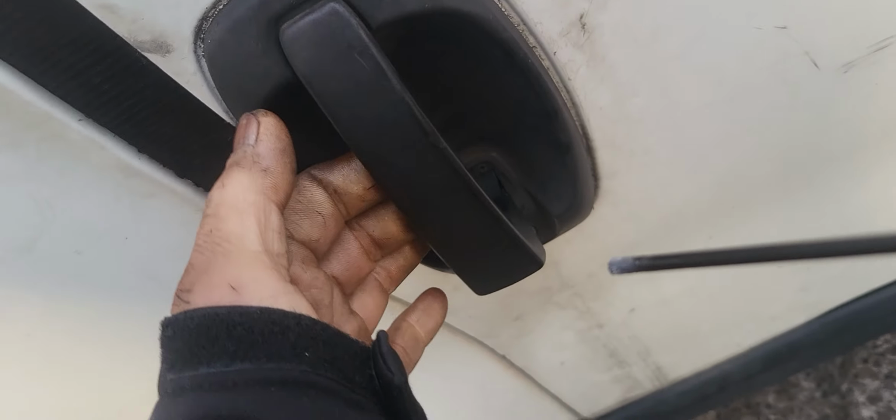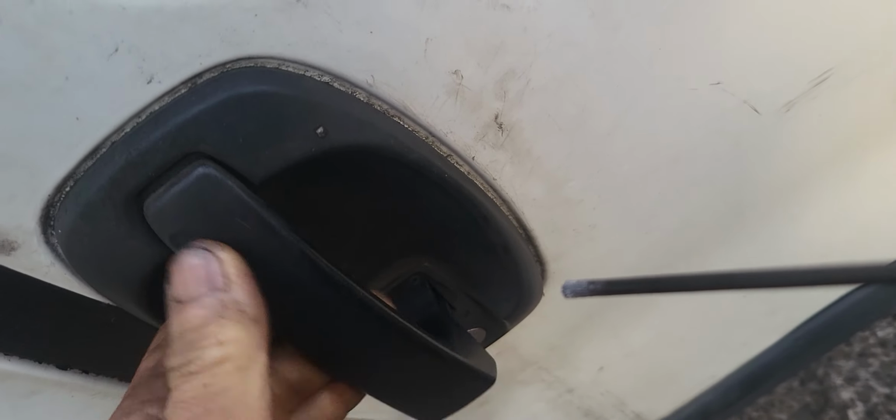And now we're going to go around to the driver's side. Remember, the door is locked, so you are doing this with the door locked so it won't open while you are spraying. So, one, spray on the top. I'm going to spray each one of the doors. Spray in here, spray on the inside. As I mentioned, try to spray on the very inside, because the purpose of that is the door lock mechanism has to be lubricated as well. Okay, and that's it.